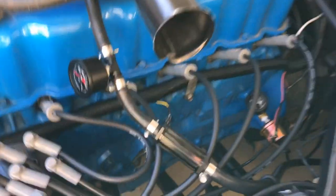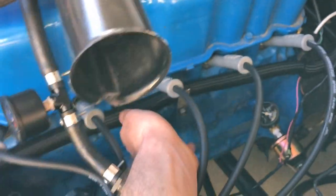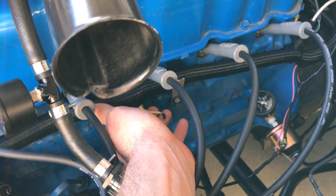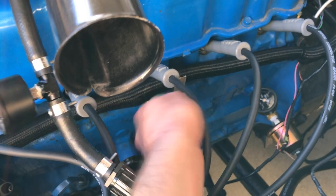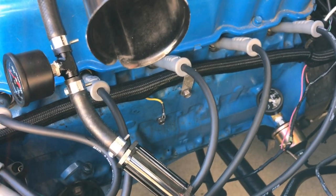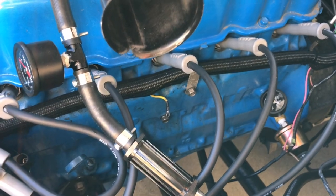The other thing I'm going to do — and I'm going to tell you guys about right now — if you're converting from a coil signal like I am, take that old wire out. Don't leave it in there. It's like a big antenna and it'll pick up noise even if you're not using it. So we're going to slip that out of there at the same time.